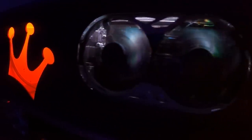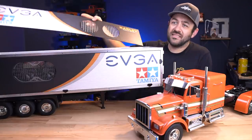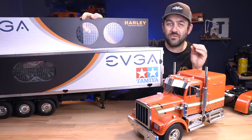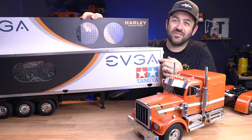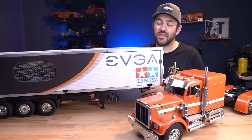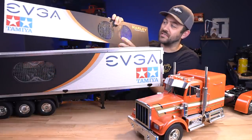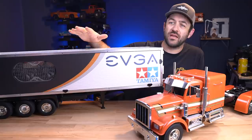What you haven't seen since the last video is this new updated outside panel. I did panels that go on both the front and back sides — this is the panel off the side you can't see right now. They're made from acrylic, laser cut, with magnets that were countersunk into the back side. Those magnets hold it onto the side of the trailer firmly, and I added tabs to hold it in place for the driving portion. There's a perforated design over where the fans actually intake on the front side and exhaust on the rear side.